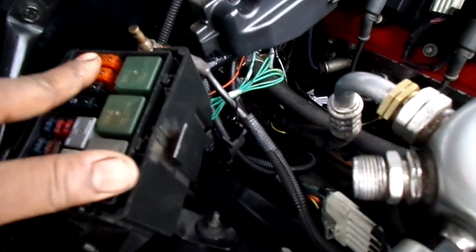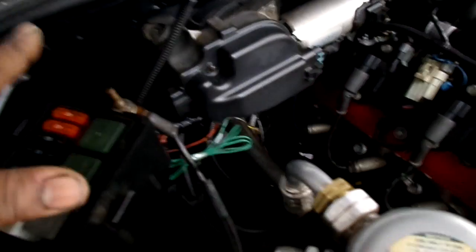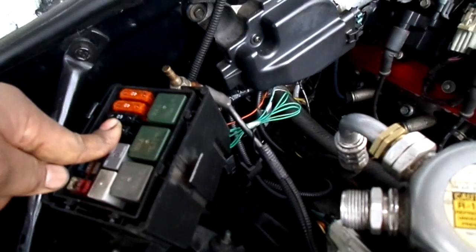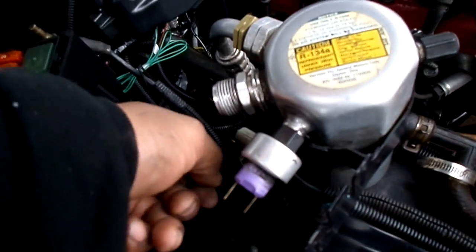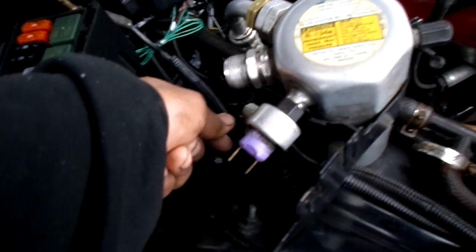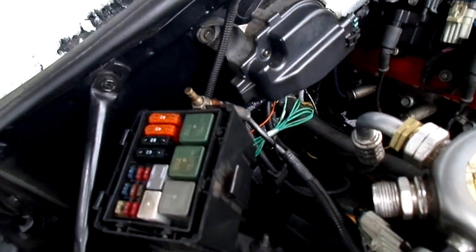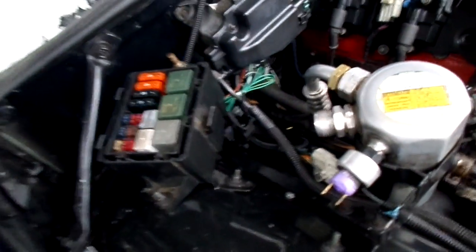The constant power is handled through only about three or four orange wires that actually go to the PCM, so those are handled through here. Then the starter relay — the red wire for jumping the fuel pump relay — I just attached that to one of the pink wires so it comes on when it's switched power.